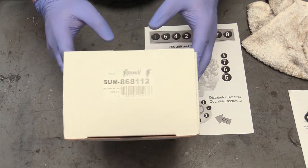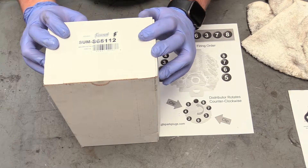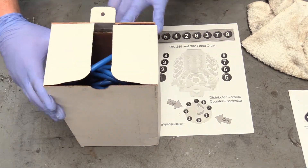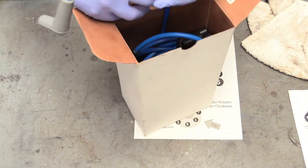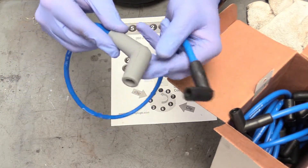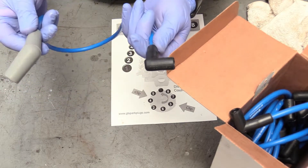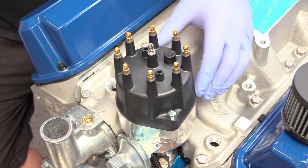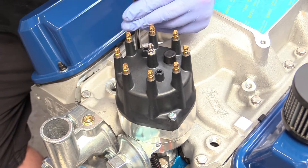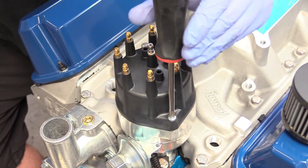For spark plug wires today, we have these made by Summit Racing. I picked blue because I thought it looked great. The only thing I'd recommend is getting 8 millimeter spark plug wires — they handle the spark a little better than smaller ones and it's better to have too big a wire than too small. These are cool because they're pre-made and pre-terminated with a 135-degree boot, so they're going to look amazing and won't touch any of our headers when we put those on eventually. So we can go ahead and place our cap — it only goes on one way, so if it's not going on, try flipping it around. Get one screw started then the other, just finger tight — these don't have to be crazy tight, just snug.